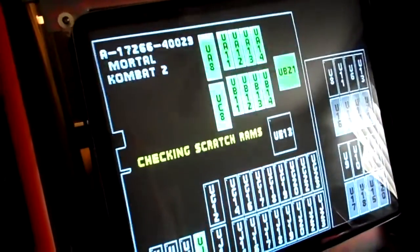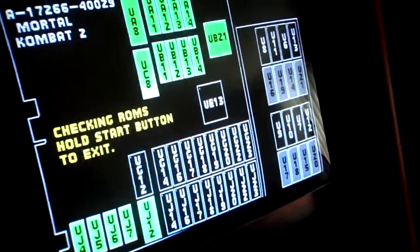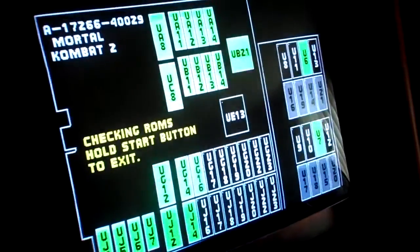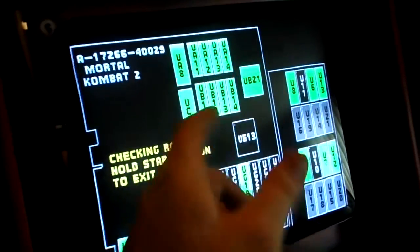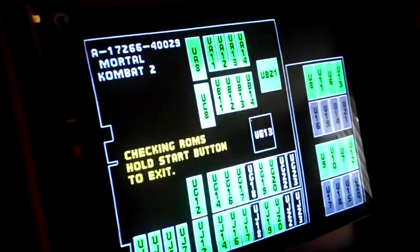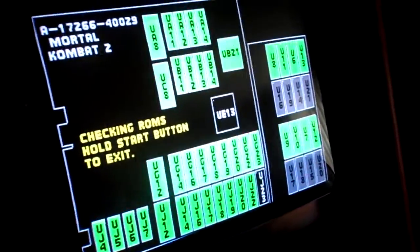Let me kill the light so we can see. I mentioned before you're going to hear a bunch of clicking and everything. Well, that's normal when you're using a computer, because it's trying to search through what resolution you're using, or what input, whether it's 15 or 31, and when your computer is first booting up, it's not outputting a video source, so this thing tends to click around until it tries to find a video source, and then when your computer finally boots up, it'll click on. So that's why you didn't hear any relays clicking that time. But trust me, if you're using this for a computer, you'll hear those relays clicking off and on.